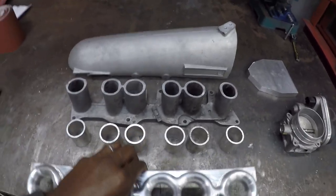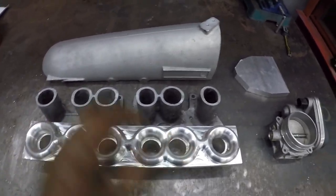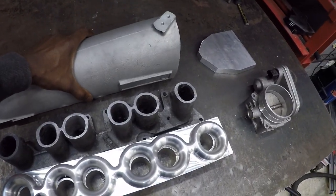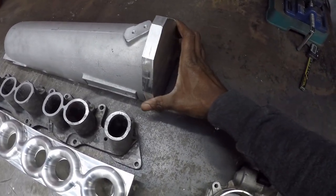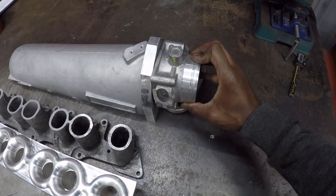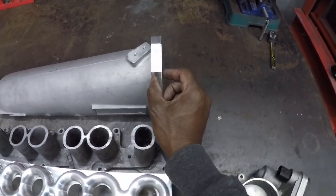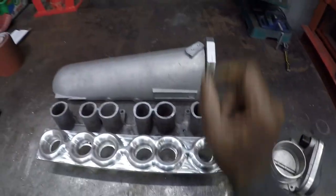So in summary, this will be welded onto these, then this whole assembly will be welded onto the lower manifold, and then the plenum itself will be welded to this. Also on the end I've got this plate which I've cut up to mate the throttle body — obviously it needs profiling and stuff but that will come after, and then the throttle body will simply bolt to it. The reason why it's quite thick is because the bolts that will bolt through this need a reasonable amount of meat to create a thread and not protrude through into the plenum — that's why it's quite thick.